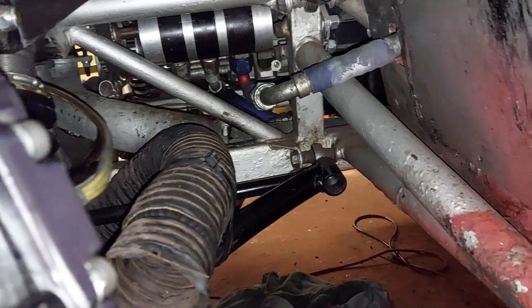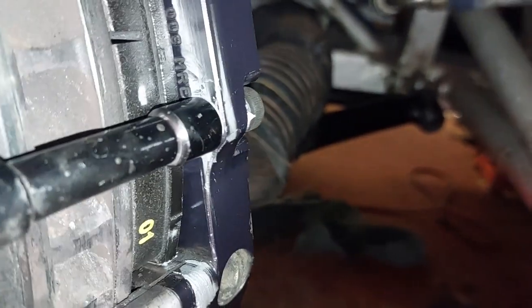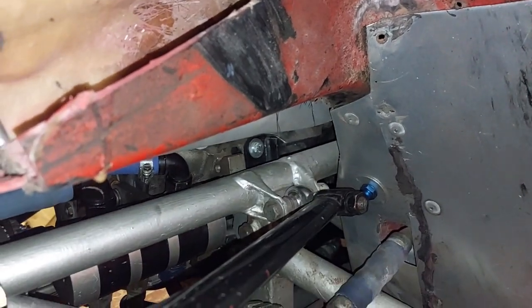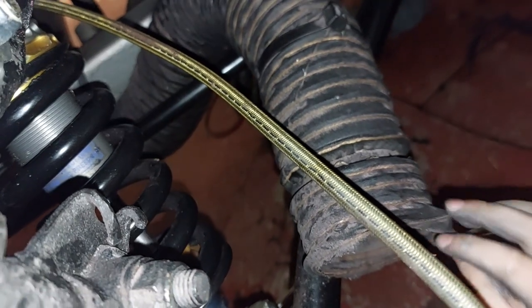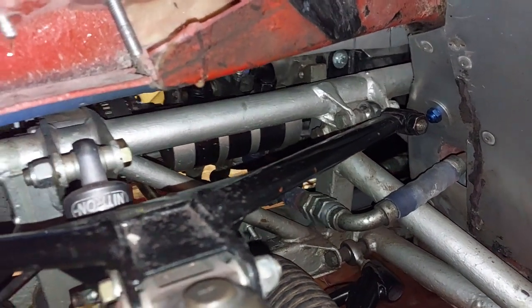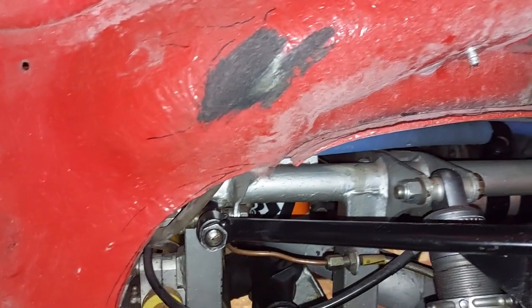As far as brakes are concerned, we only needed to do the fronts. I'm not doing anything with the rear ones - leaving them. I didn't need to clean the discs up in the end because when I had a quick inspection the grooves are actually fine. Any debris will clear with the first turn of the wheel. Next job on the list will be a spanner check - we'll get that done. We spotted a little issue there that needs sorting - something that always seems to come loose.